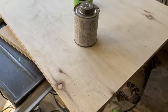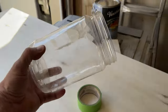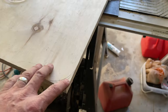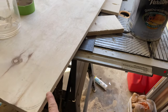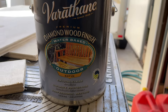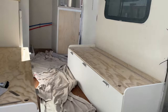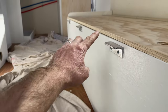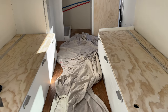I've just been trying to figure out the proper radius for the corners, using different things to get it right. I settled on this — I think it's a mayonnaise container. After I've radiused the corners, I've got a router built into my table saw and I'm just going to router the edges fairly lightly all the way around, then sand it. I'm going to use this stuff to seal it — I'll seal both sides before I put the legs on. This is what I use to support the table, or support the bed. I just took some of that angle iron bracket I had and made some of these the right height — three of those there — and it just slides in nice and easy. It's the same length as the bench.